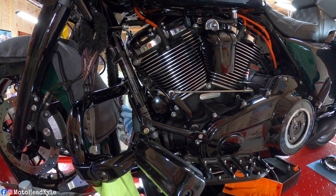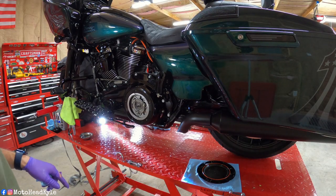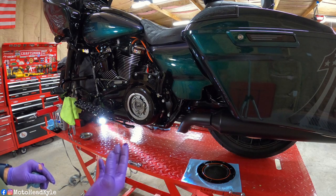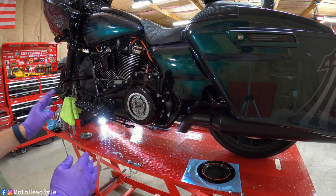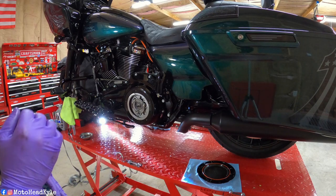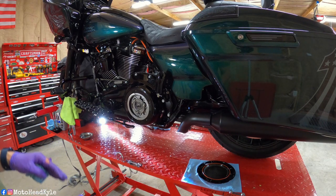So at this point, we're going to go ahead and clean up our drain plugs, inspect the O-rings, and reinstall the drain plugs. All right, so I just went ahead, cleaned and inspected my drain plugs, and threw all three back in. I'm not going to mention the torque spec, because every bike is slightly different. So therefore, I recommend you check your owner's manual and or your service manual for the torque specs